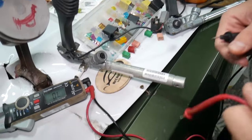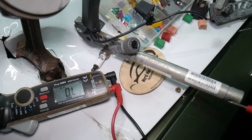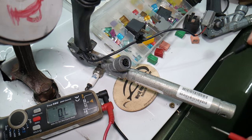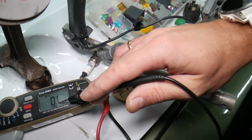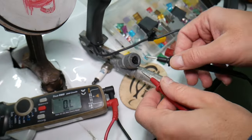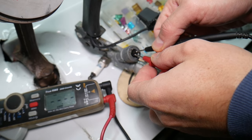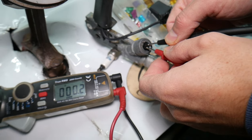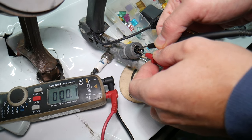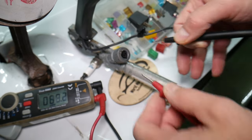Consider this video for entertaining purposes only — not a how-to video. It's part of the airbag system and if you're not qualified and certified to work on airbags, it can lead to bad problems. Now here's what we have: the voltmeter set on ohms. I get one lead on one wire, the other on the other one, and the reading we get is zero ohms. Zero ohms — that's the bad one, that's the blown one. That's how we know if it's bad.